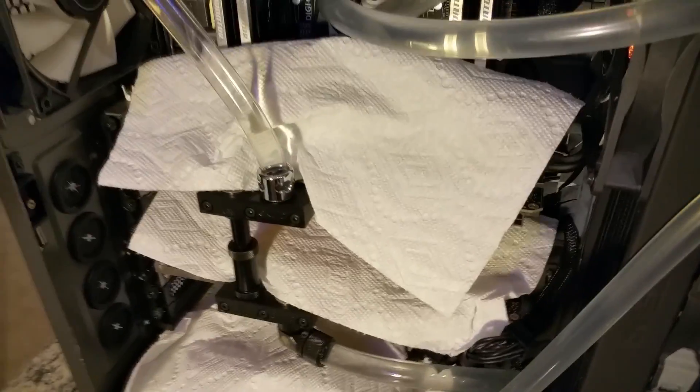After running the loop for a few more hours I will be booting, and I hope I didn't break anything when I attached the water blocks. I did have to use pliers to get the standoffs for the back plate screws off the graphics cards. I tried a hex extractor drill bit but it couldn't get enough grip, and needle nose pliers also couldn't get enough torque to remove the standoffs.